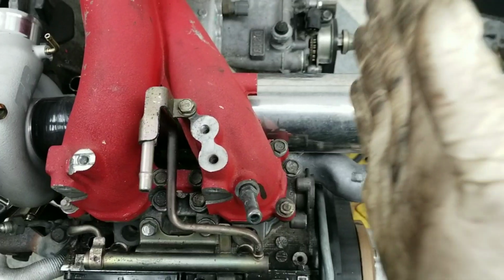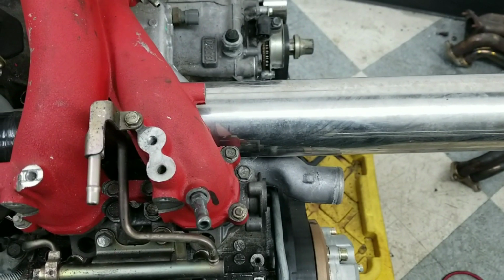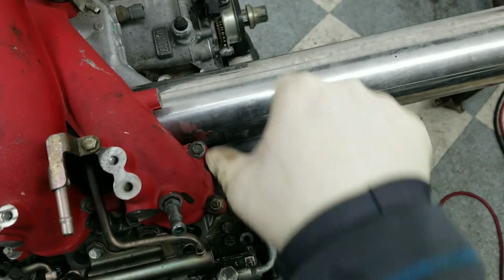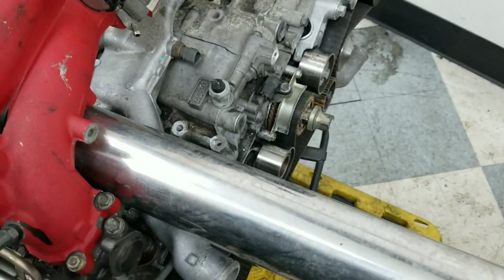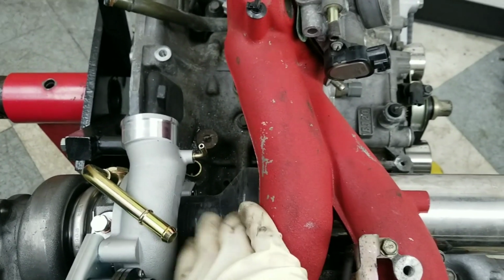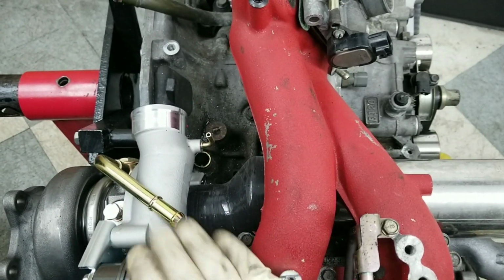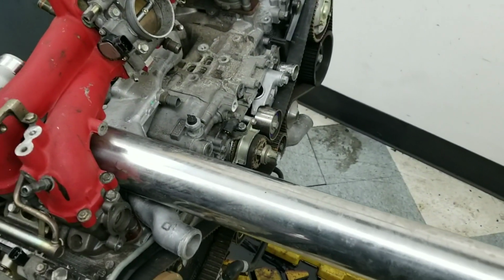So what we're going to do is I'll probably have to buy an aluminum mandrel, although it's going to need to be a pretty tight bend. I might do it out of stainless. This is a stainless pipe. So if I cut it here, I might be able to run, because I do want to run the intake down over to here. The other nice thing is if in the future I go with a big 3-inch inlet, they make this same coupler designed for 3-inch as well. So I could just run that if I do get a bigger turbo. So build something once, that way it works forever.